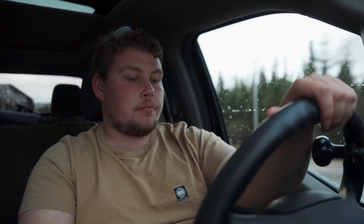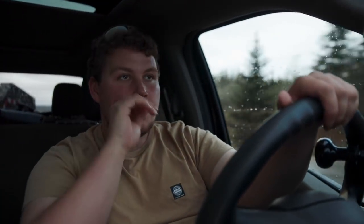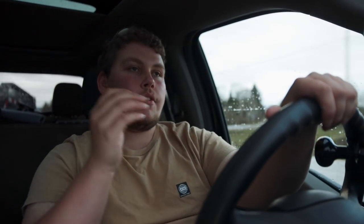So when I'm stopping, I usually grab the trailer brake manually, get on the foot pedal, and at the same time, I can use this hand here to hit the downshifter to get the engine brake cut in. And I find that really slows it down quickly. So in combination with me having a light bar, if a moose comes up, I have more than enough time to slow down, and I can do so with gears, trailer brakes, and truck brakes.